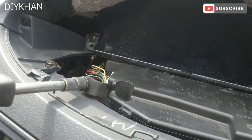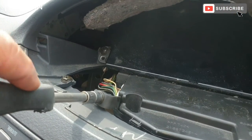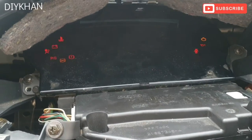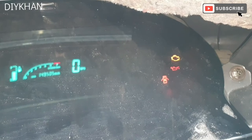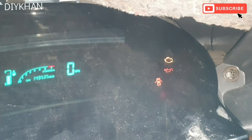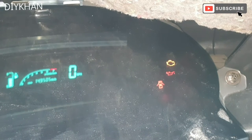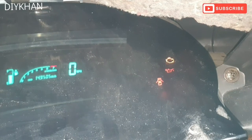The fourth and last screw goes in here. Before I put the trim in, I just want to show you — there we go, now we can see the engine management light, which the previous owner or car dealer had removed to sell the car. We ran the diagnostic and it came up with a bank one oxygen sensor failure, so at least we now know what the issue is with the car.